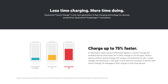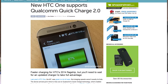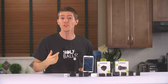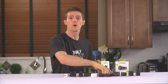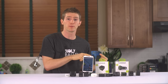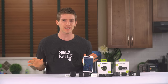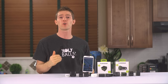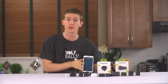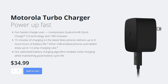Version 2.0, which started showing up in devices like the HTC One M8 in early 2014, takes the on-device hardware a step further and allows it to accept up to 3 amps from a 5-volt power supply, and even other voltages as well — up to 12 volts. The tricky thing is that while both the devices and the chargers are backwards compatible with older, lower-power ones, to take full advantage of Quick Charge 2.0 we need drastically different power sources that can deliver greater current and varying voltages. So if you want to be sure it supports Quick Charge 2.0, check the box. It'll say Quick Charge 2.0, and it'll come with a pretty steep price tag for a wall wart.